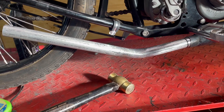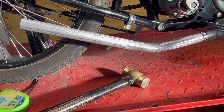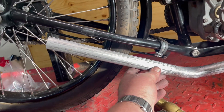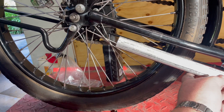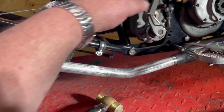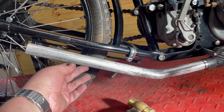I'm having a bit more of a crack at the exhaust. I just heated it up with a blow torch, bent it, and thought 'oh well.' I had the pipe left over from another project and thought I'd just have a crack. I've done a pretty good job — I'm actually pretty happy. There's a tiny flat spot here but you've got to be looking for it. I've got the bend of the pipe about right; it'll go up the frame about right. I've shortened the pipe at the back so it doesn't foul the stand and can hug tighter to the bike. The kickstarter clears by a good half to three-quarters of an inch. I can put a baloney cut — as the Americans would call it — or a splice on the end of the pipe to make it look slick.